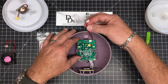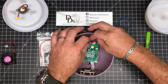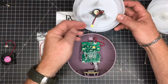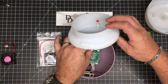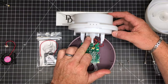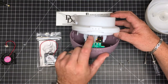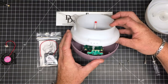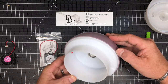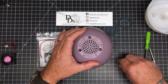Circuit board's back in place. Now it's time to plug the fan back in — the fan plugs right into here. In this diffuser it's color-coded: white connector to white. Tuck the wires down in here. Yellow connector to yellow on the board — that's pretty easy. Every one I've seen is like that. Give the fan connector a good click, and plug the disc end back in to the board. Align the lid so that the three little dots are in the front, aligned with the switches and the lights. Take your time getting this together and make sure everything is straight and tight. Then flip it over and put in the three screws that hold the whole unit together.